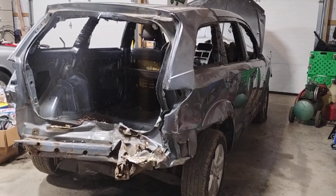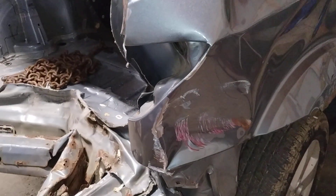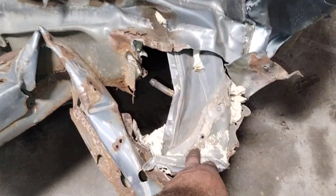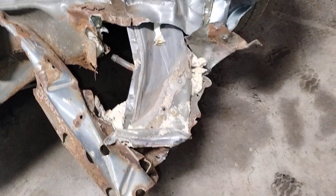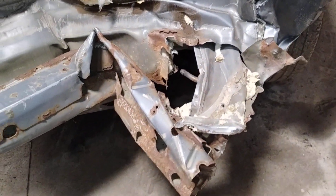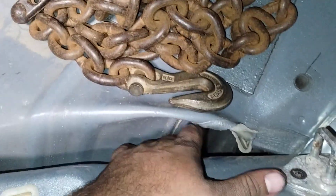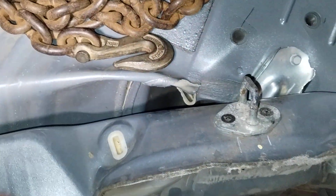So here's what happened. Got a nice corner shot, did a nice corner shot. Caved all that in. Subframe — you got that little tweak right here, but for the most part still relatively straight. Spot welds ripped off. Kind of pretty much crushing this in. This used to be where the jack and stuff all sat. So that crushed it real nice.